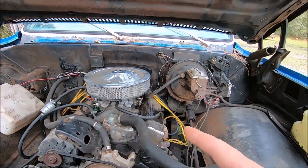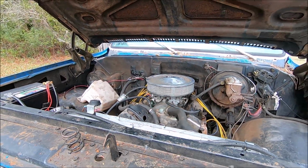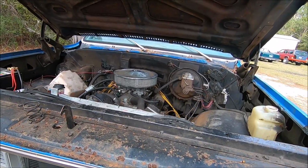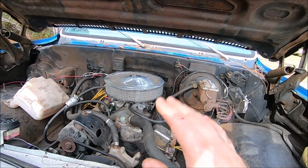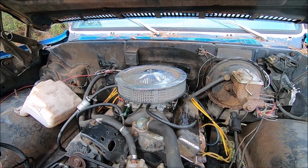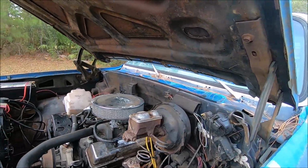I tested the accelerator pump. I know that works. So maybe I'm just not used to cranking it long enough on a cold start, or maybe I'm not pumping it enough, giving it enough gas. I'm not used to having to just pump the snot out of these trucks. Usually mine just start right up with 1 or 2 pumps, but you know, maybe half a dozen, or keep pumping it till it starts. It seems to want a lot of gas to get going.